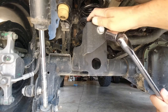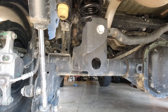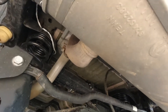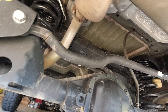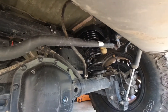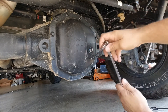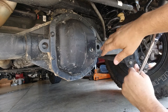Check the other end of the rear track bar — this side has a flag nut on the back. That's tight. Go through and check all your shocks. Also look at your exhaust and make sure it isn't all beat up, because dented-up exhaust can cause engine issues. Give everything a good once-over, looking for anything that looks abnormally beat or might need attention. Check for greasy dirty buildup around your cover on the rear diff. Same as the front — use a three-eighths to pull the fill plug; your fluid should be right at that level.